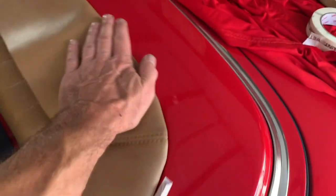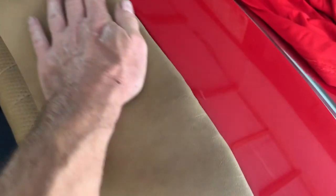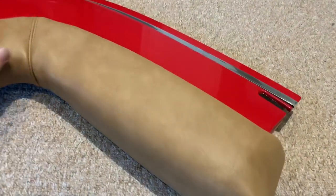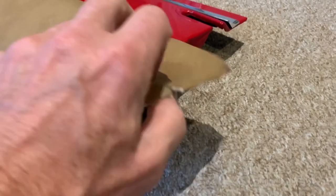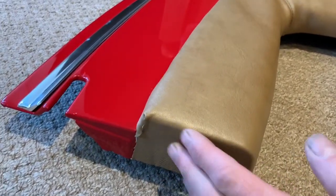Just fitting that on to make sure it fits in all the holes. It's really difficult getting rid of all the creases. I have no doubt there will be professionals thinking I'm doing it wrong — however, I've never done it before so I've just got to work it out for myself. The hardest bit of this car to trim has proven to be this horseshoe here, and I think in order to do it I'm going to have to take it off without scratching all the paint. I've redone it to the best I can — it's slightly better but still not perfect, still not as smooth as I'd like. The way I've done it on this side is to use a hairdryer to stretch the vinyl over.